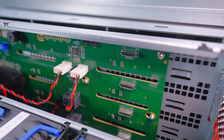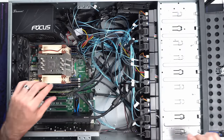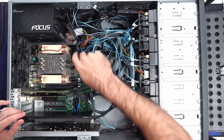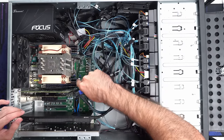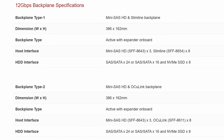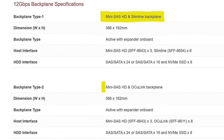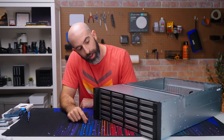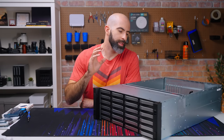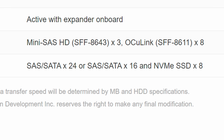One of the main differences is that this chassis has a backplane and my current setup doesn't, which means all of my drives are connected directly to the HBA via a SAS 2 4x SATA cable. This backplane comes in two flavors: a Slim SAS model and an Oculink model. And Oculink means there must be NVMe — and yeah, this backplane does SATA, SAS, and NVMe.